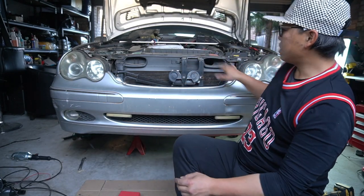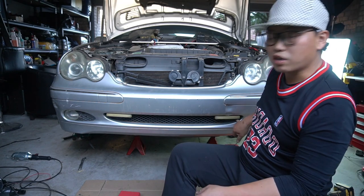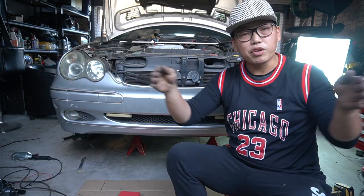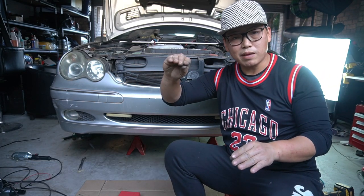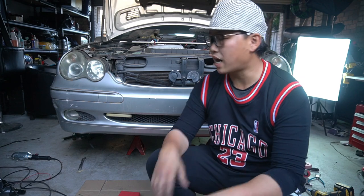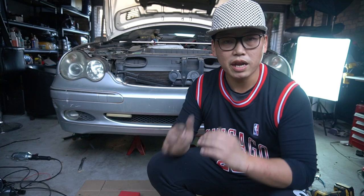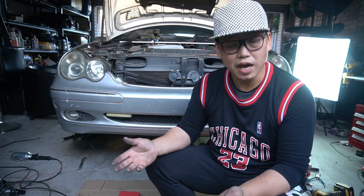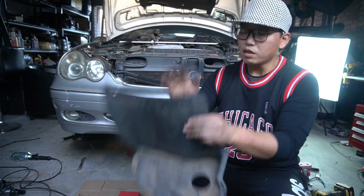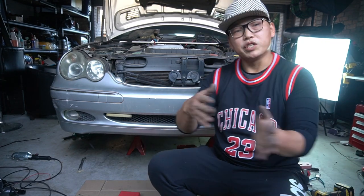After that, we're going to remove these two 8mm bolts here and we'll also remove an 8mm bolt inside next to the fog light. All that's left would be the two brackets that hold the front bar to the fender panel and there's a Torx screw there as well. I have jacked up my car and removed the wheels to make this easier, but when doing this you do not have to remove your wheels nor do you have to jack up your car — you can simply leave it on the ground.